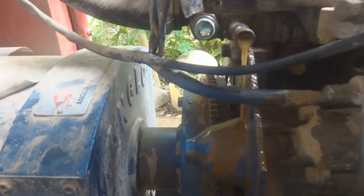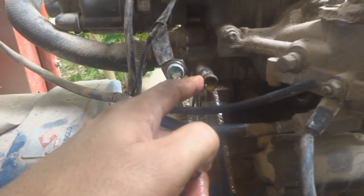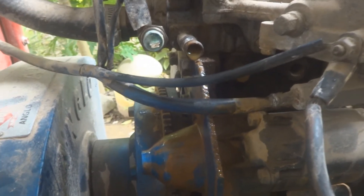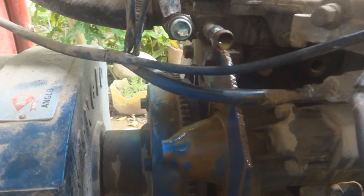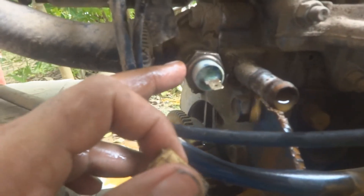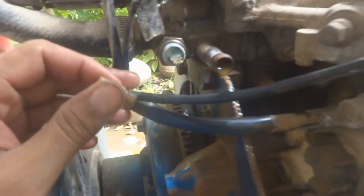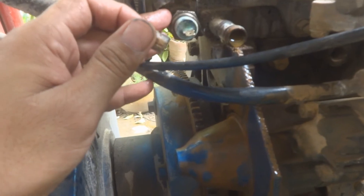The arrangement I am making is — I am not only trusting on the rubber dead plug, because it leaked and eventually a catastrophe can happen: the coolant will leak, and the whole engine will burn. That is not a desired thing at all. Also, these people did not take care — you can see here, this is the temperature switch and the terminal is open. They did not bother to wire it. The function of this temperature switch is something I will also show on camera — the testing of this switch.